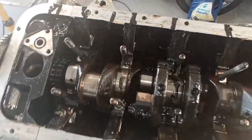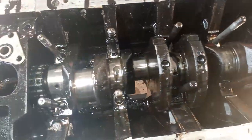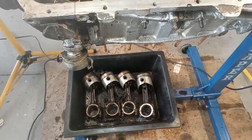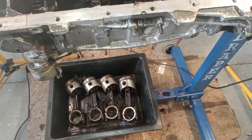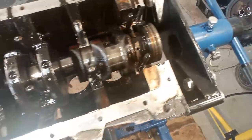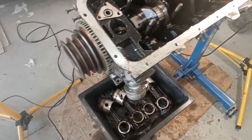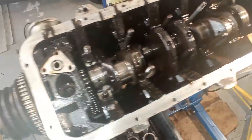On the bottom side I believe there are things I can use. The bearings were not spun and the wear is not that bad — that tells me the crankshaft may be of some use someday and that the con rods are not bent. So I have four con rods I can use, and the pistons appear to be in good condition apart from the rings. It all depends on the liners, so I need to take the engine to the machinist to remove the pulley and do measurements with tools I don't have.